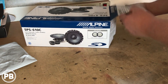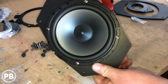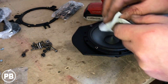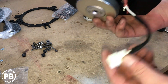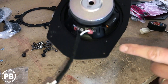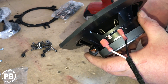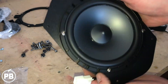It comes with plenty of screws to get those mounted. We've got these all good to go. Additionally, we hooked up the Metra wiring harness — these are the 72-6514 for Dodge and Chrysler vehicles. We went ahead and hooked in our wiring harness. These Alpines are designed so that you actually hook the tweeter and crossovers into the spade terminals on the back of the speaker. But since the tweeter on this vehicle is in the dash, we won't use those, and we'll wire directly into the speaker terminals in the dash itself. This will plug right into the factory speaker harness.